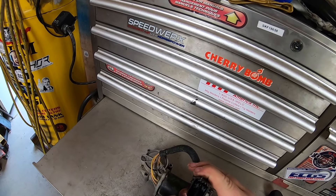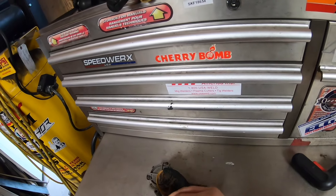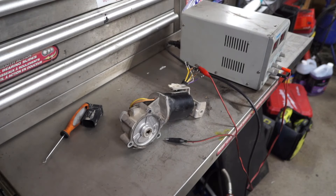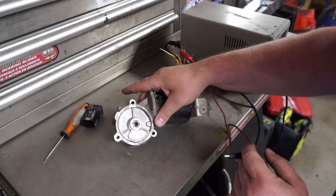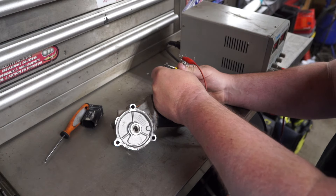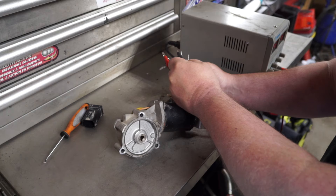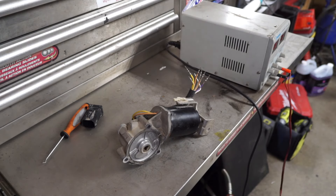I'm not saving this, so I don't need to worry about damaging the little locks for the wires. So I was wrong — the orange and yellow wires are bi-directional depending on which way it's turning. I got the red on the orange and grounded the yellow — it went to the end and that was clockwise. Then I switched it and touched the ground on the orange — it went counter-clockwise and stopped at the end. So the transfer case motor does indeed still work.